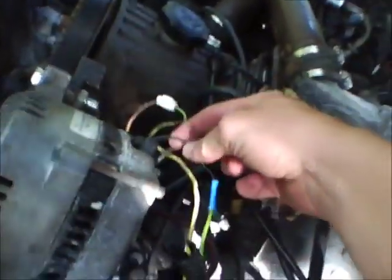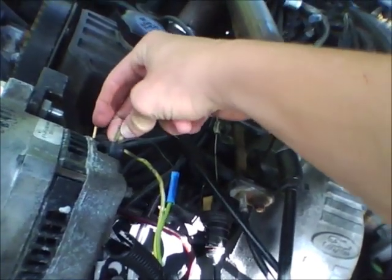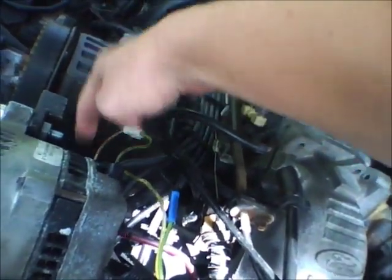To explain what the S, I, and A wires are: the I terminal runs to the gen light, which is the alternator light, and it's typically green and red — that's your I terminal wire which was in the middle and is now off to the side. Your S terminal wire simply jumps over to the stator plug and is typically white and black — I took the S wire and jumped it over to the stator. Your A terminal is your yellow wire, which typically runs via fusible link to a 12 volt source. That's all you really need to do.